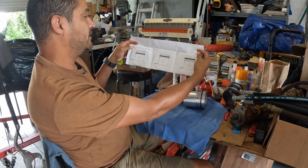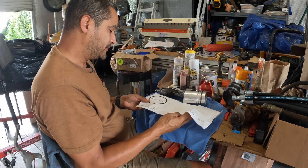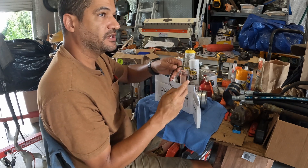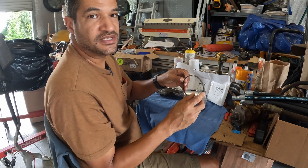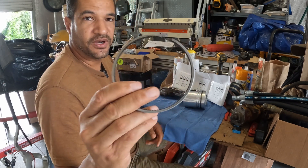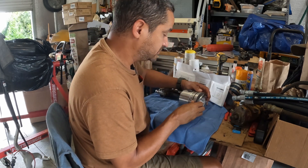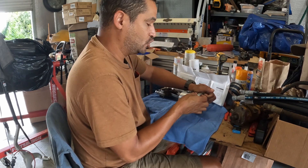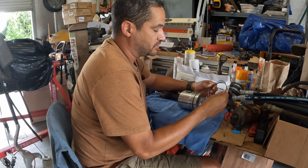The package tells you how it goes — it actually labels out the rings for you in a convenient little package. I start from the oil ring, which this one is actually all together. Other ones come in three pieces: a thin lower metal one, then a spring, then the third one. But this one comes all in one. When you put these on, you just gently put them on. There are ring tools that spread them out, but I don't use those.